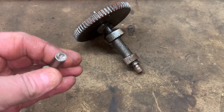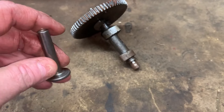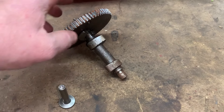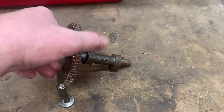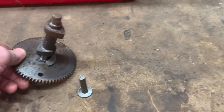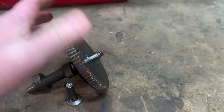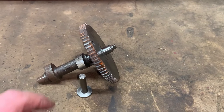As you can tell, this lifter here is dished — this is for a push-rod engine, probably like a 17 or 14.5 Briggs. This is the very old style, one of the first camshafts for the 14.5 or the overhead-valve Briggs single-cylinder engines. They've since upgraded this to the skeletonized pressed-on lobe camshaft, and this will not interchange — this camshaft will not fit the newer ones.